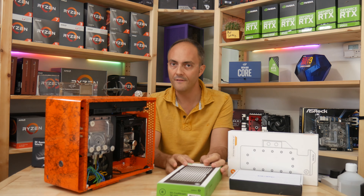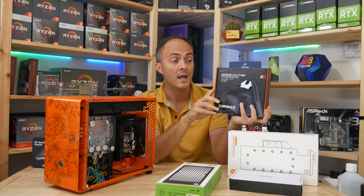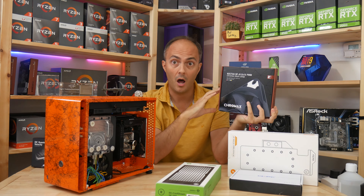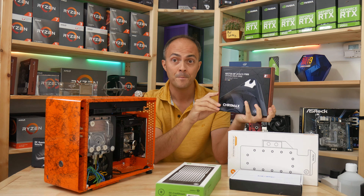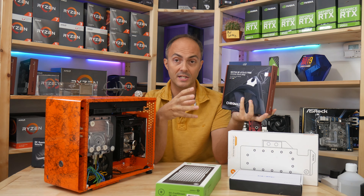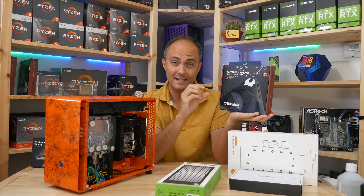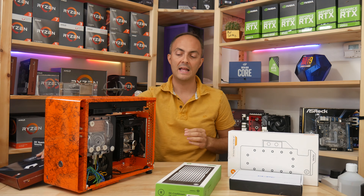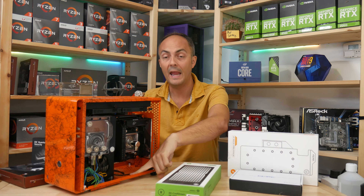To make things a little bit neater, what I've actually done is gone for a couple of these babies — Noctua NF-A12x15 PWM fans. The '15' gives you a clue: they are just 15mm thick. For Mini-ITX builds they're just godlike. I've actually tested them myself compared to some other premium full-size 120mm fans, and there's next to no difference — really great static pressure and airflow. In pushing air through a radiator they're within range of some of the best 120mm fans out there. And given that they give you an extra centimetre of clearance in this case, it's meant that I can fit a full-height radiator in the roof, and also fit a second radiator and third fan in the bottom of the case as well — something I haven't seen anybody else do in the Ophion Evo.